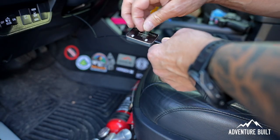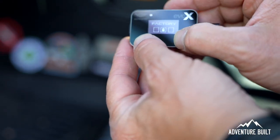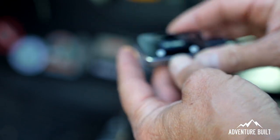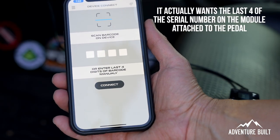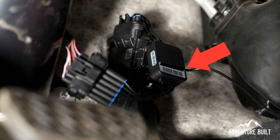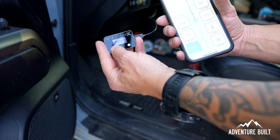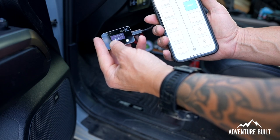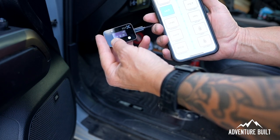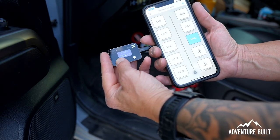Once you've got the USB-C out, all you do is plug it right into the Ultimate 9 on the side. Now we turn the power on to the vehicle. With the power on, you're going to push both left and right of the silver buttons at the same time. It's going to give an ID number. I'm going to put that ID number into the app. The previous screen wanted the last four digits of the serial number on the device itself — the part actually attached to the pedal. So I go underneath there, get the last four of the serial number, and now I'm into the actual functionality of the app. The only way I could really tell my app was definitely connected to the remote was when I clicked the buttons on the controller and it actually affected the app. So now I know a hundred percent that it is connected. This thing is pretty cool.